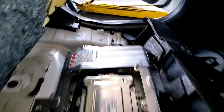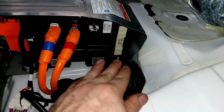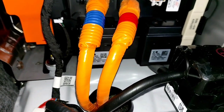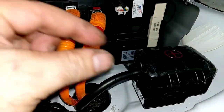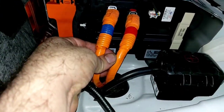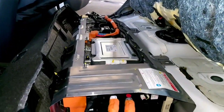This is our access to the high voltage system bus bar connector. On the other side we have our low voltage system and the junction block. The junction block contains the main contactors — relays that are activated by the low voltage system. The low voltage system activates the high voltage relay, the relay closes the circuit, and the high voltage starts to flow through two main wires directly into the front of the vehicle's inverter assembly.